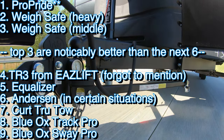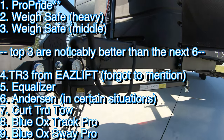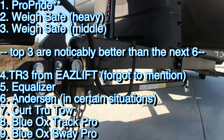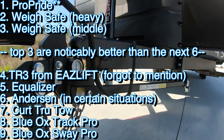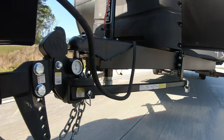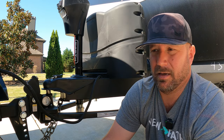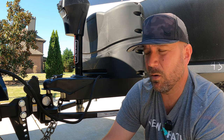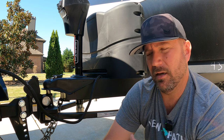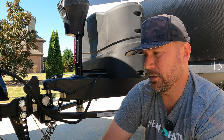If you're under 30 feet with a very adequate tow vehicle, Anderson's good. Believe it or not, that little chain hitch from Anderson is super easy and super lightweight — but it's got to be in the right situation. You need a trailer under 30 feet with a very adequate tow vehicle. Even if you're 26 feet in something like a Kia Telluride, you're going to need more than the Anderson. But if you're in a three-quarter-ton truck towing a 30-foot trailer, it performs really well — I was honestly surprised. Once I get the B&W done, we'll do another video talking about all 10 hitches.